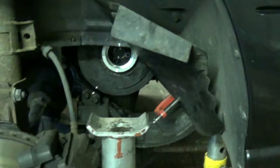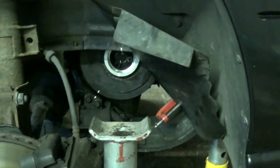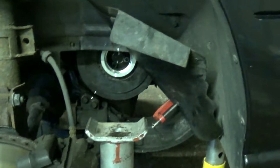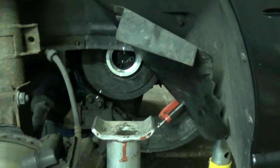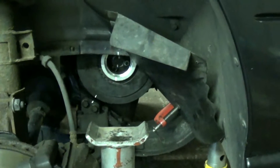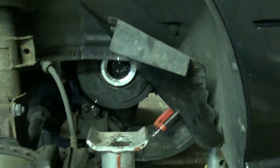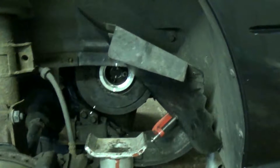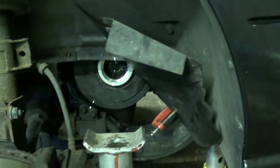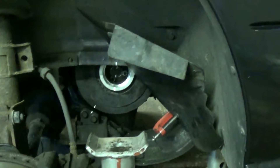So be warned, this is a pretty heavy duty task. Don't attempt to do it if you have any condition where you're not supposed to overexert yourself. Next thing I'm going to do is go ahead and tighten those four allen bolts that are in there. The setting for those I believe is 20Nm then 90 degrees, or a quarter of a turn.